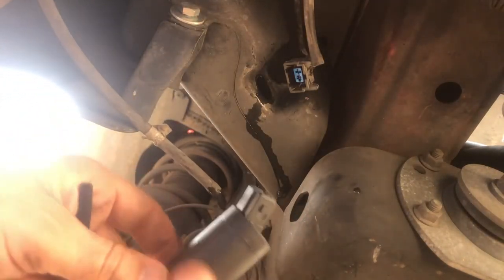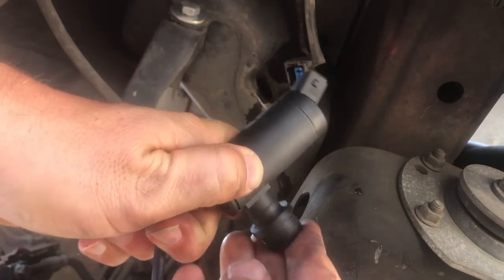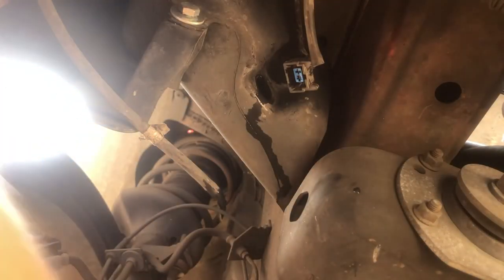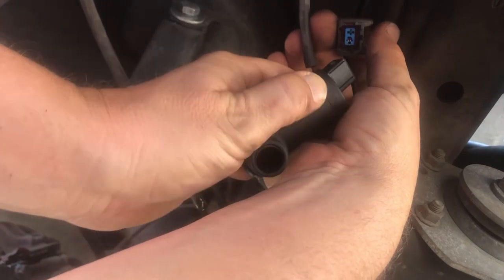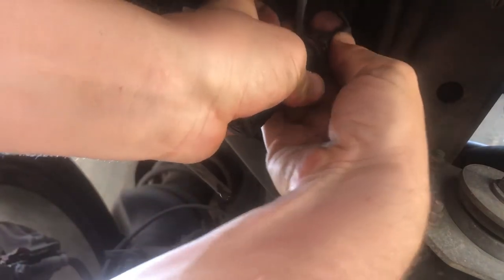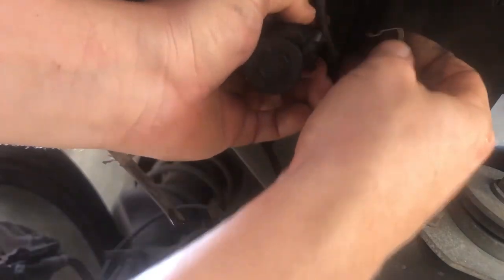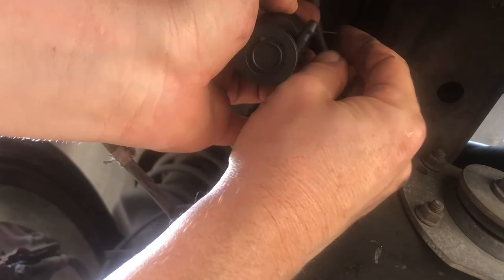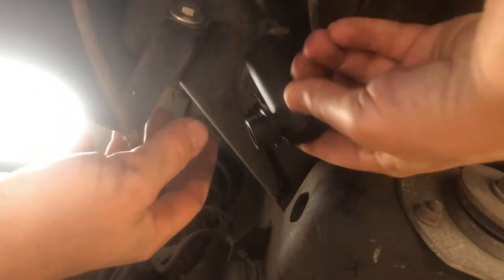I'm not sure which of these hoses is which, so all I can do is try each one and see. You've got the new rubber seal there - that just goes on like that. We'll put the electrical connector on now - that can only go one way. There's the click. We'll click this little metal clip back on to hold it in place. Now this just sticks into the tank like so.